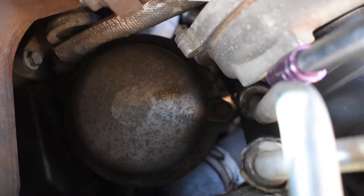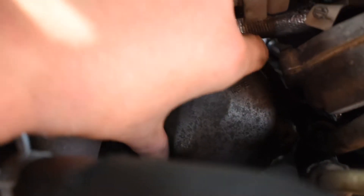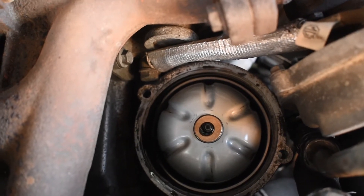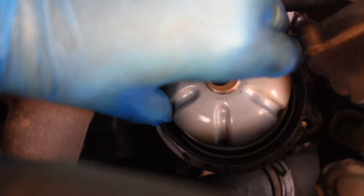We're looking at this bolt here and this bolt here — they're both 10mm. I'm going to gently undo those now to release the cover. With the bolts undone, this cover should just gently lift off. It's not actually attached anymore but it's a tight squeeze, leaving the rotor itself exposed. Now I'm going to take the rotor out — grab it by the top and lift straight up off of the spindle. And there it comes.